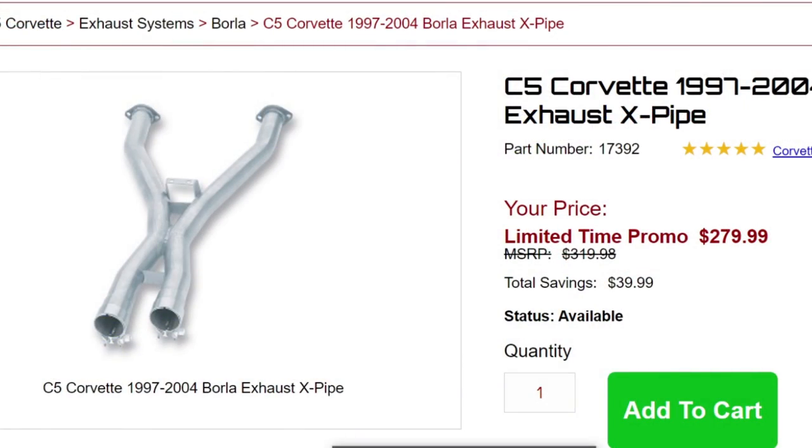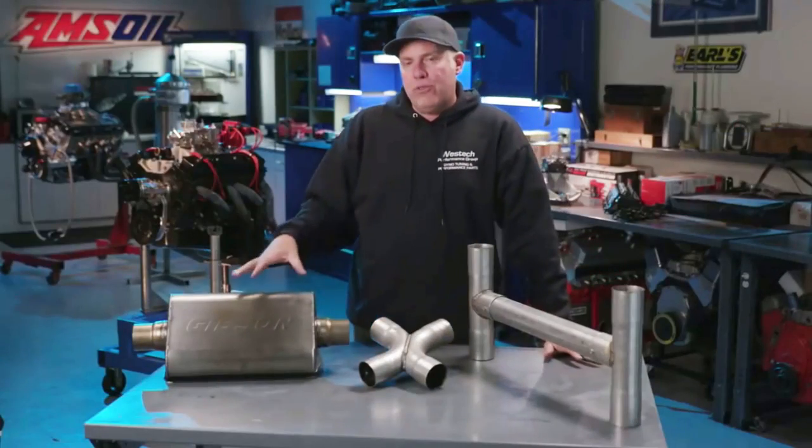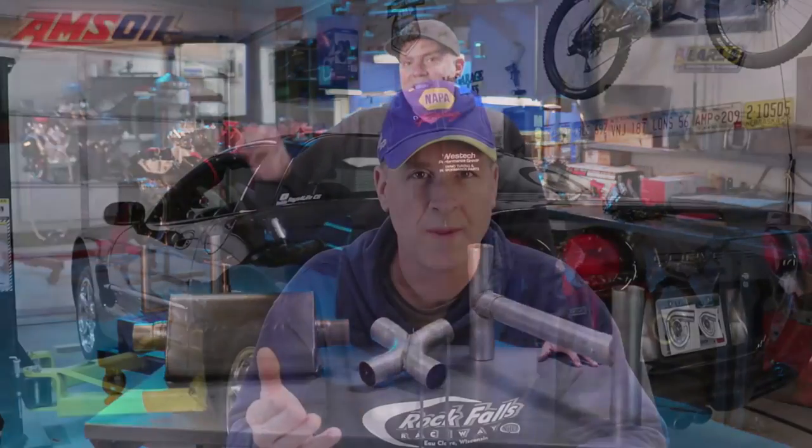Now a lot of you might say, why don't you just go ahead and use an X-pipe? That's a reasonable suggestion. Engine Masters recently did a shootout between straight dual exhaust, dual exhaust with H-pipe, and dual exhaust with X-pipe — I'll include a link in the description. Basically, both the H-pipe and the X-pipe picked up torque and a little horsepower in the low and mid range, and both were basically the same in the upper RPM ranges. What they all agreed on is that the sound differences are quite significant — some people like the X-pipe for its more exotic sound, and some prefer the H-pipe. So that's going to be up to you.